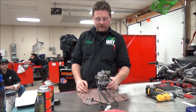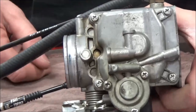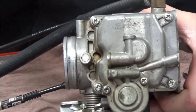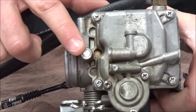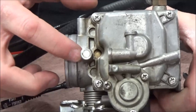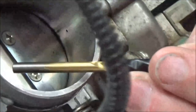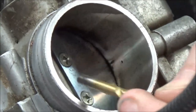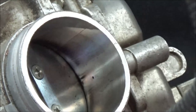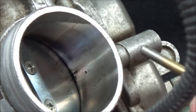I cannot believe we have a virgin carburetor here. It's been a while since I've seen one of these. This right here is called a welch plug. We're going to walk through the process to get this plug out, because underneath here there's actually an adjustable screw which adjusts the fuel mixture. Right in front of the butterfly, you're going to see this hole there. If you follow that pathway up, you'll see that channel goes with the casting here for this fuel mixture screw.